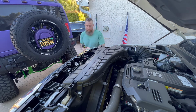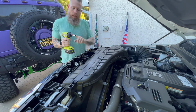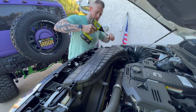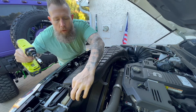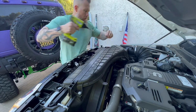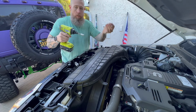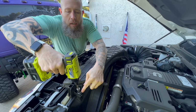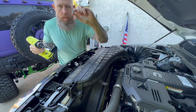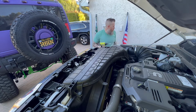Next, obviously, I'm grabbing my electric tool here. This is the 10mm socket with the chuck on it. Basically, what we're going to do now is remove the 2 bolts on the corner of this little air intake. Super easy. There's one, and then there's one more right here. Again, these just hold in this ram air portion that shoves the air into your air box.